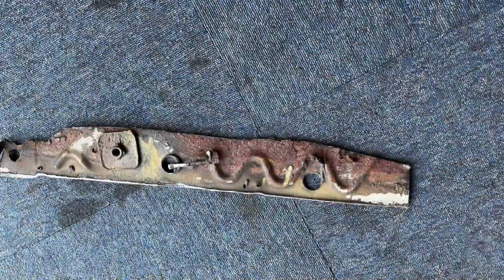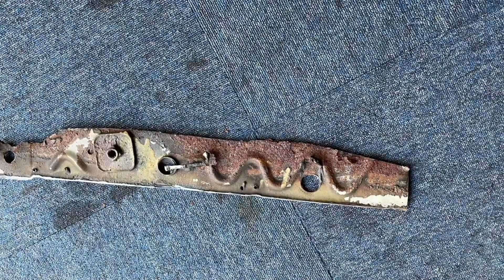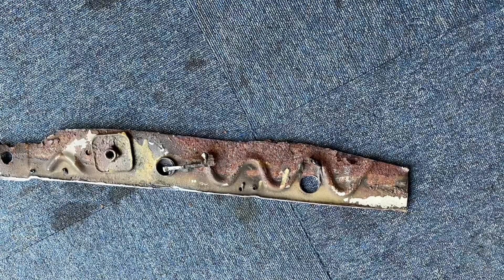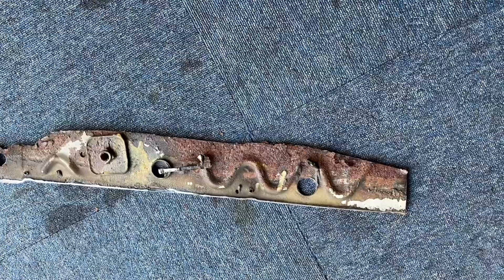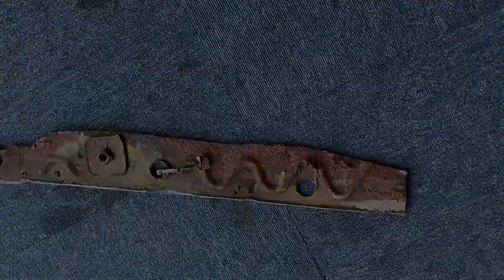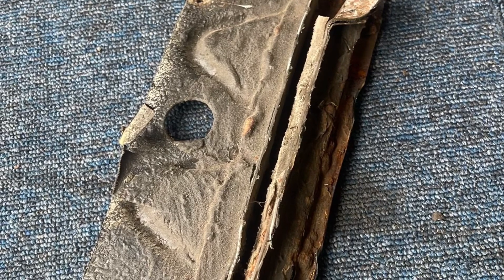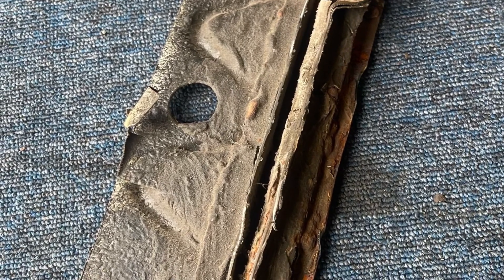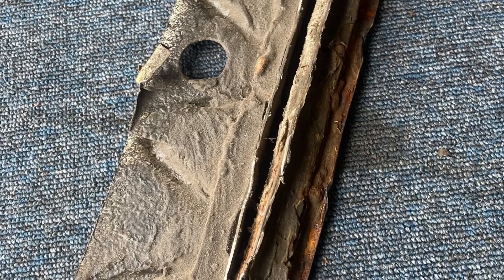This is the section of the inner sill I cut out. As you can see it was quite heavily corroded on the inside and it would never have been possible to clean this up. Although the top half looks okay where the wax oil had been previously, it obviously burnt away when they did the repairs. Here are sections showing the layers - there must have been about three quarters of an inch between the floor pan and the inner sill section, with the old floor still in the middle, so no strength whatsoever.